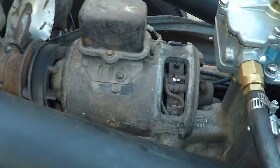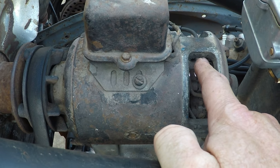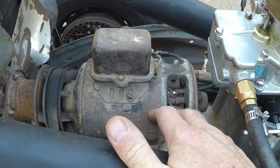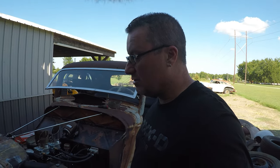I think I'm going to run it there for a little while and see what it does. That's your adjustment — that's how you get more amps out. The very lowest setting was only like maybe 3 amps, which wasn't enough to really charge. It's kind of like the difference between a trickle charge and a fast charge. I wanted it up higher so I can still run my headlights without draining my battery going down the road. So there you go guys — that's the magic sauce for the generator, that's how you adjust it and check your cutout. We'll throw the cover back on and get going. Thanks for watching — like, share, and subscribe. See you later!